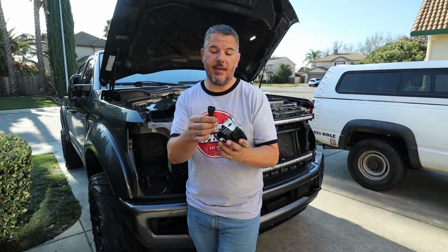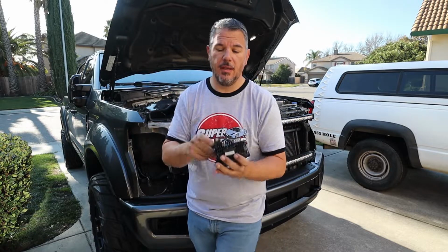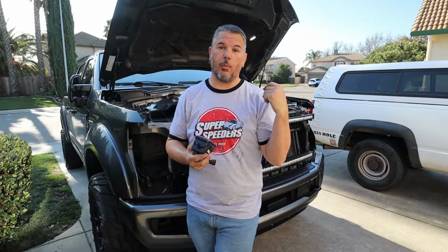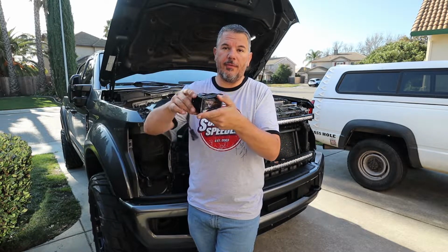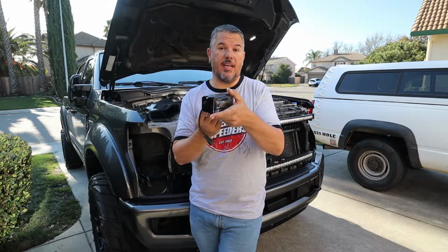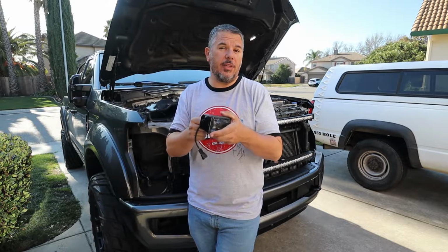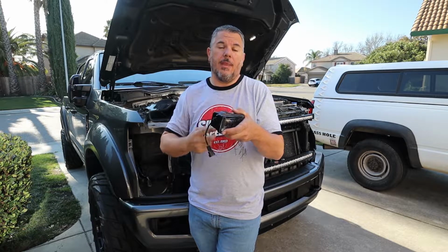All right, so we finally have everything pinned up, and as with the first set that I showed you, the positive and the negatives, I've done it here as well, and made sure that I've got the little white plastic piece put in there for the set screw. Now these, I clipped in one side, everything went in fine, it just clipped in real easy, but you'll notice that they're a little bit flimsy. They move like this, so that set screw in the back is going to set those heights. So depending on how these install, hopefully when you put the set screw and the spring in there, it just keeps everything nice and tight.